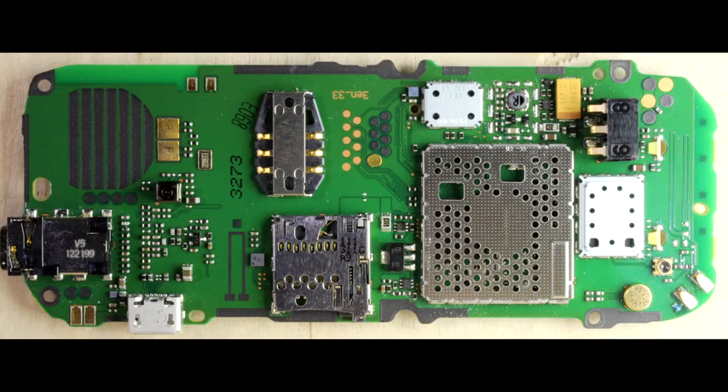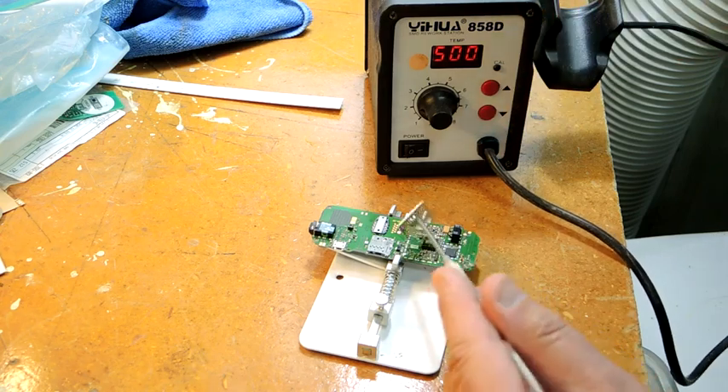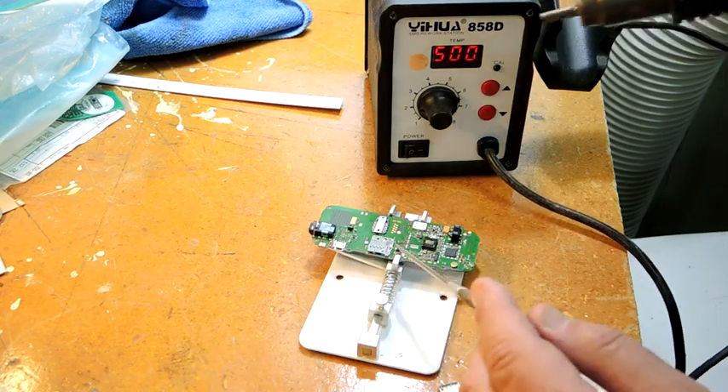It's a single circuit board in this phone — old school. It wasn't held together by glue; it was just screws, which makes it much easier to disassemble than modern iPhones. Looking at the back of the circuit board, there are three obvious metal cans — those are Faraday shields. Pop those off and you can see a whole bunch of integrated circuits sitting there.